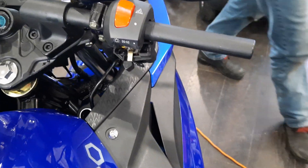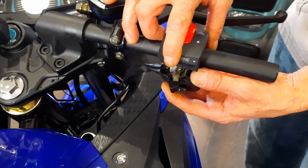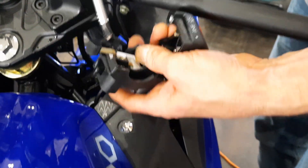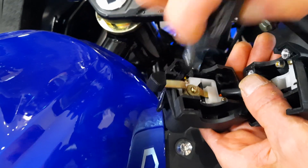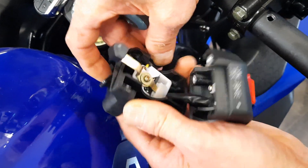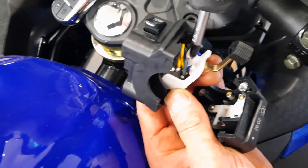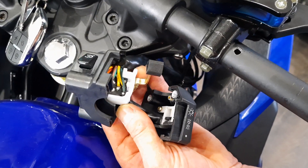The other connection you want to check is actually in the switch itself, so you'd have to get the throttle off — it can come off easier but sometimes needs a heat gun. Just pull it off. There are two screws holding that together. Now this isn't the bike that has the issue — this is just for demonstration. You lift that up and those are the last set of connections you want to see connected. How many are there? Five — there's five.